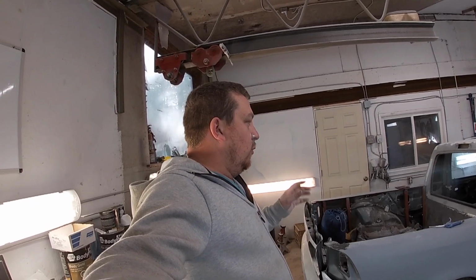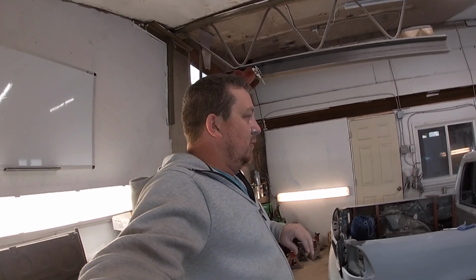So we are using high build primer, which is designed to go over 180. We back sand everything with 320. So we should be perfectly fine to go.